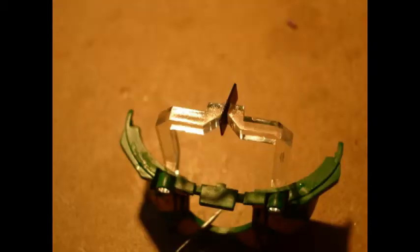You'll be left with two halves, and now you're going to need to glue a piece of black plastic between the two. I used a KD shim — KD part number 211 — and you can use MEK-type glue or super glue. If you're using super glue, be very careful that it doesn't get on the light surface. I recommend leaving it overnight because you want the glue to be fully cured before you put it back together.